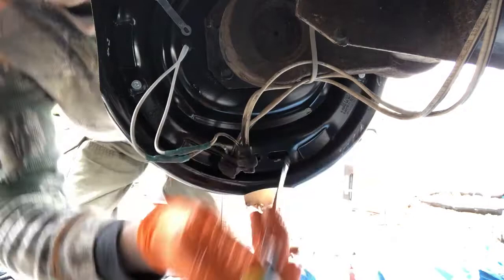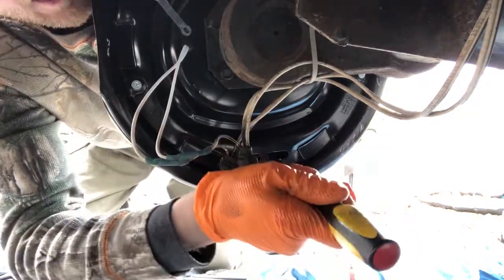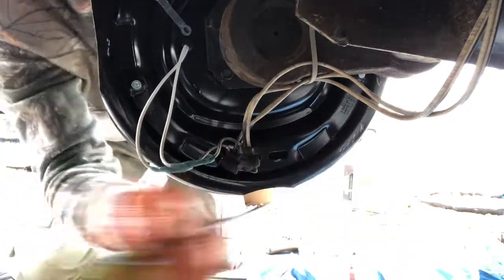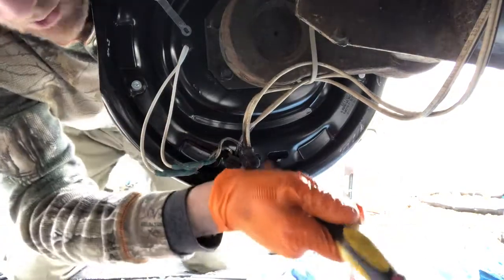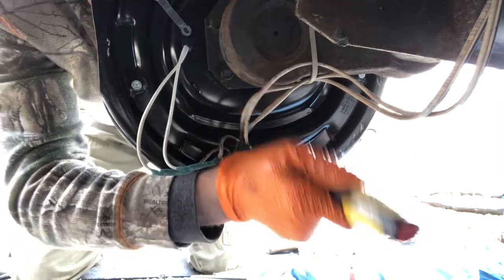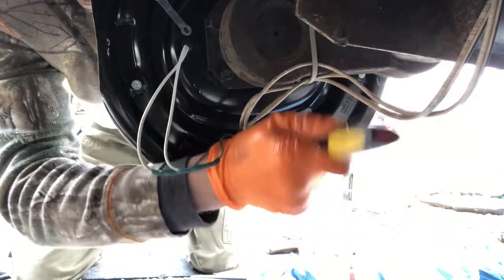Keep in mind: when you do this, after the first hundred miles you're gonna want to do this again. So for that, all you gotta do is pull the plugs and dust caps, jack up one wheel — or use some two-by-sixes to roll the back and front tires onto, which will automatically lift the other tire off the ground, which is what I do — and then just make sure your wheel is spinning nice and free, not grabbing on the brakes.